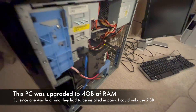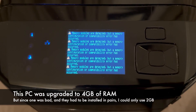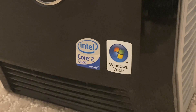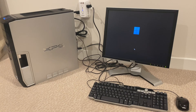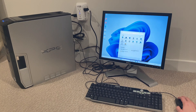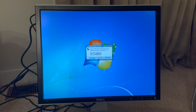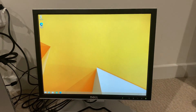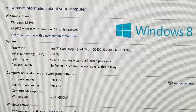Doing this process on Windows is more difficult and may be more time consuming depending on how knowledgeable you are with older computers. I spent weeks troubleshooting the issues with the system I found, only to discover that it might have been water damaged, leaving some components like a RAM stick faulty, which caused random shutdowns and error codes when booting. I also had challenges determining which operating system was best. This system shipped with Windows Vista, which everyone knows was a disaster, so my thought was to use Windows XP, but I had trouble even getting the install started. I then tried Windows 11, but it was unusably slow. Windows 7 seemed like a good choice, but I constantly ran into random errors and crashes. I ended up settling with Windows 8.1, which had the best balance of modern features and good performance.